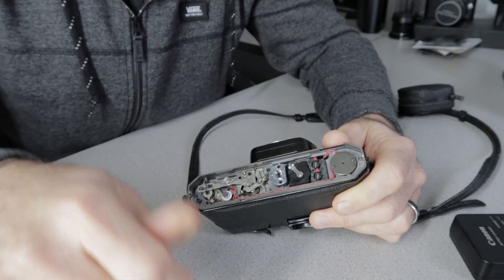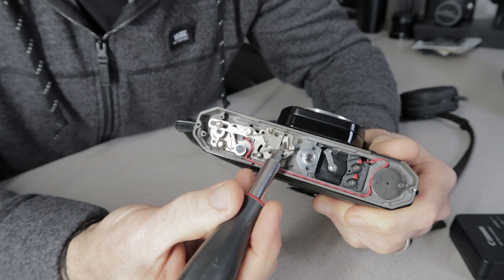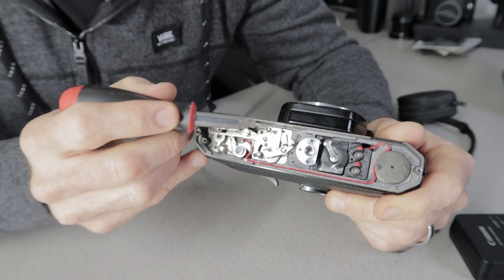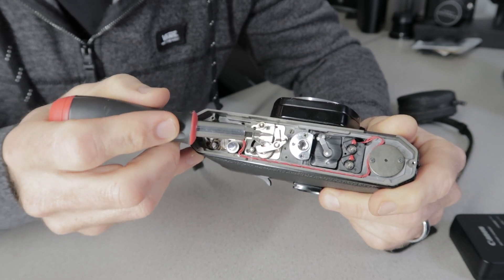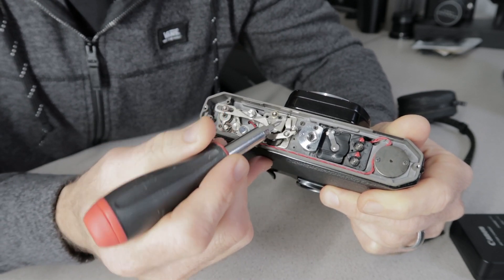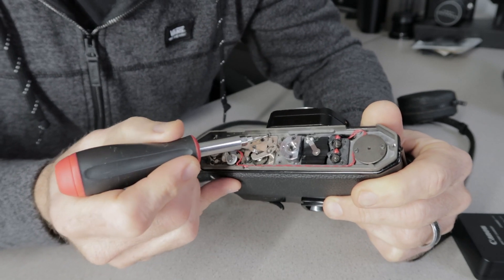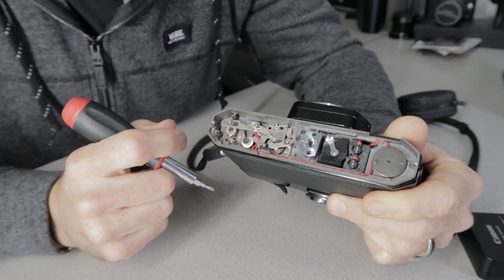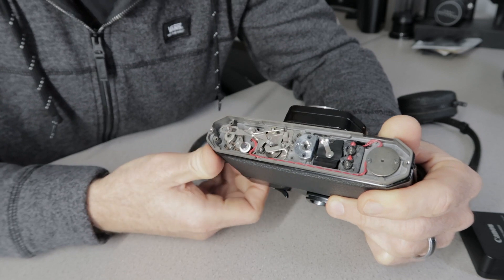The plate just comes off, and inside we can see a little arm. The mirror is currently stuck. When this arm comes back, there's a little lever at the top and this lever gets stuck on a gear. We're going to take this lever out and grind the corner a little more to about a 45-degree angle. I've made a mark with a black marker so I know not to go past it and grind too much off — just enough to allow that arm to come down every time.